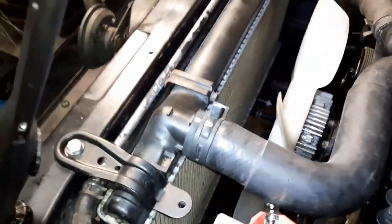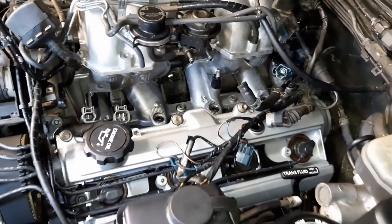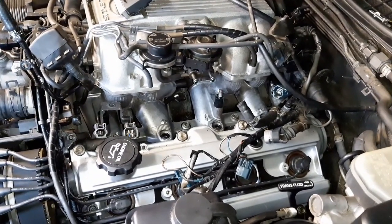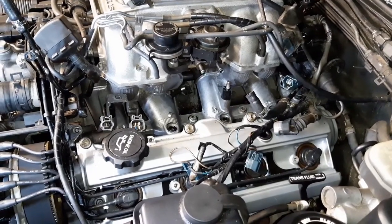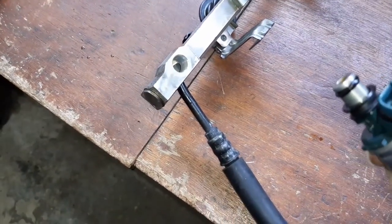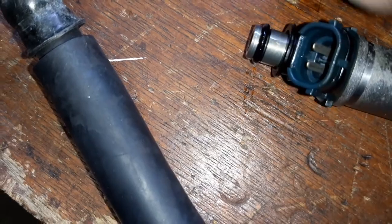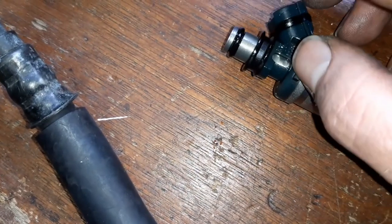When I checked this side, nothing was leaking — and then all of a sudden the rearmost injector was leaking like crazy. It was like a fountain, a shower of fuel. So I shut it off and it really demotivated me. I'm not sure how to carry on from now. I took the injector rail out and it's currently here on my bench with the number seven injector out. It was a bit crooked around there. At least the o-ring is not broken, so I'm going to check all the others.